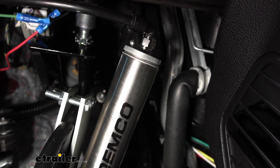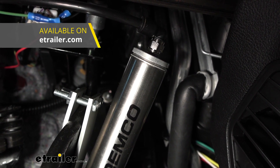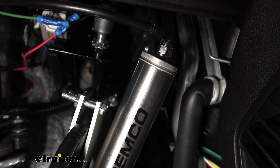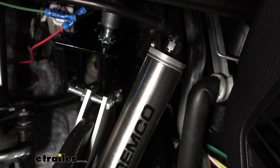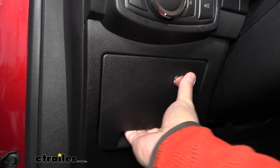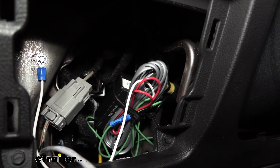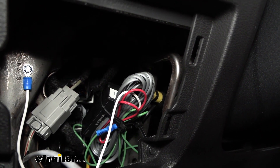Not included with the kit but installed on this vehicle is a brake light switch — basically a plunger that goes to the brake pedal and knows when the pedal is being applied. That sends the signal to our wireless coach link, or if you have the LED indicator light option, that's how it makes the signal to let those lights illuminate, letting the driver know brakes are being applied. Mounted behind our fuse panel, I have our wireless coach link zip-tied up, tied into that brake light switch, and it sends the signal to the coach link wirelessly.